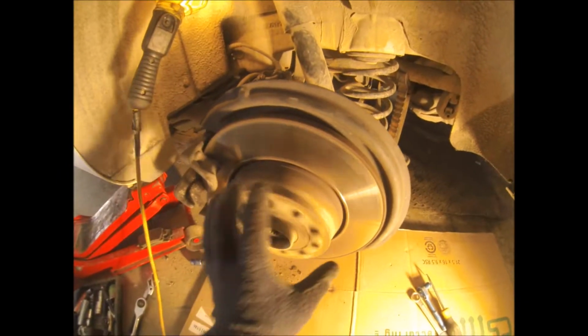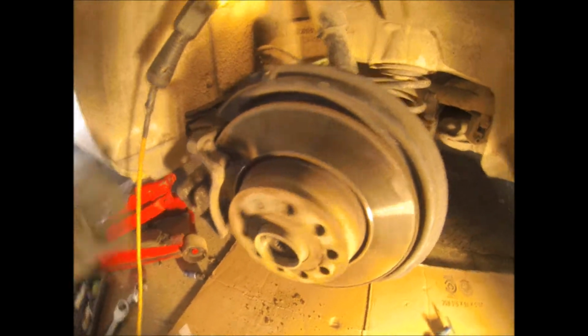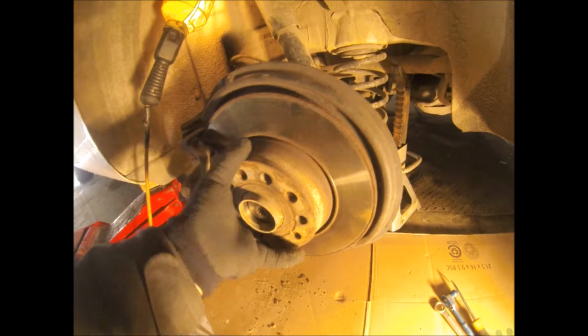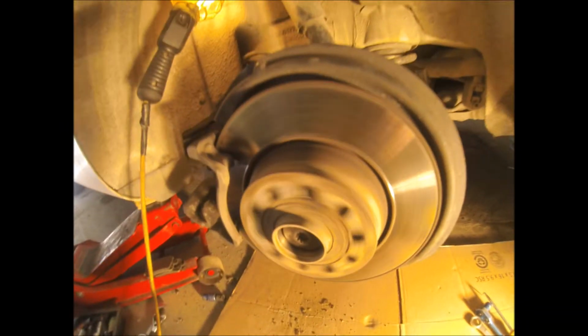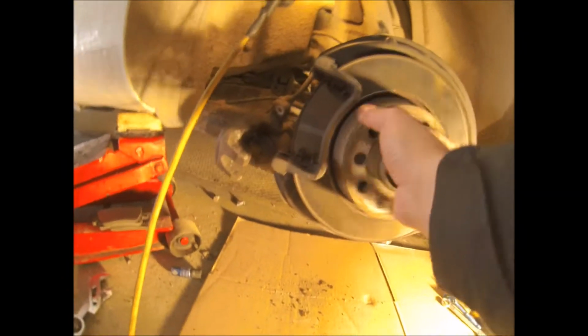So you can tell the bearing is free. There's no weight on this bearing, and it's noisy already. The vehicle's up on the jack, and the bearing is just floating there, and it's already making a noise. So imagine if you have the tire on there and then drop the vehicle down, and the bearing will be all preloaded and stretched with the weight, and the bearing is making noise already. You can have a big humming noise. So definitely the bearing on this one.